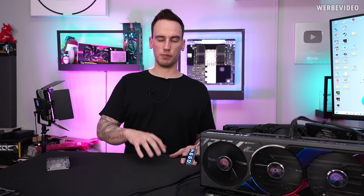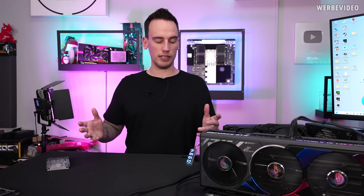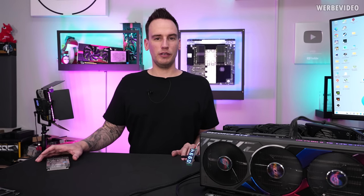The PCIe slot physically doesn't appear damaged. I provided images to experts on my Discord and they couldn't find anything related to traces either. It's just unfortunate — sometimes things like this happen out of nowhere. It could be an issue for liquid nitrogen overclocking to chase some records, because losing two or three percent — which is typically the bandwidth penalty — is something we probably won't be able to make up for, but we'll do it anyway.